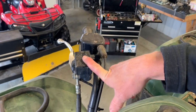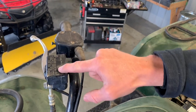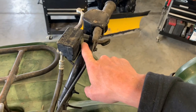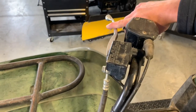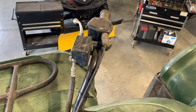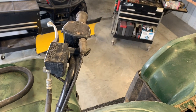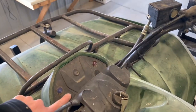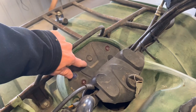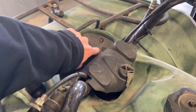We've got your hydraulic master front cylinder here — this is your reservoir. It takes DOT 4 brake fluid. Undo these two screws if you need to bleed those brakes. Make sure the level is good — you can see your level through that window on your master cylinder. This just controls your front brakes. You've got disc brakes in the front, which is a much more efficient style of brakes on a four-wheeler. So you've got hydraulic front brakes and manual drum brakes on the rear. On the dash, this is a pretty simple, plain four-wheeler — no speedometer. You do have a neutral light, reverse light, and oil temperature light, so keep an eye on those.